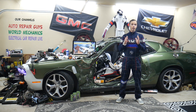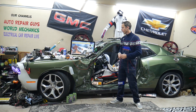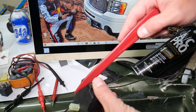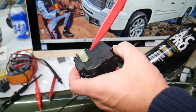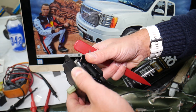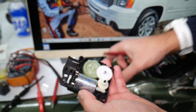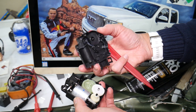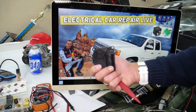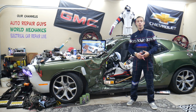Now, there could be something completely different where your AC works perfectly fine and everything is great, but it still doesn't blow cold air. It could be due to a device like this one — you may have one or two. If you have a dual climate control on the front, you will have two of those; if you have a single climate control, you will have one. This is known as a blend door actuator. It attaches to a flap that switches from hot to cold. If you open that device, you have multiple gears on the inside — usually they will crack, wear out, or the motor will burn, and it will be stuck in the hot position. Even though your AC works perfectly fine, it will cause it to not blow cold air and hot air will be blown instead. A bad blend door actuator costs only a few dollars. If you want to see the symptoms of a bad blend door actuator, we have more information on our main channels.